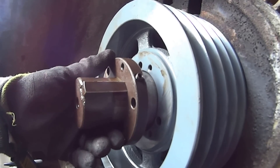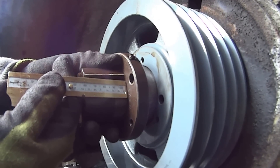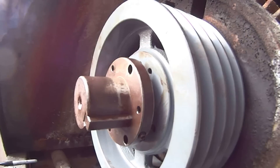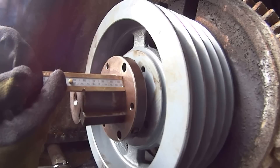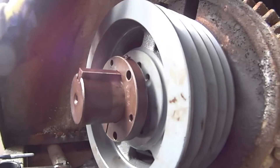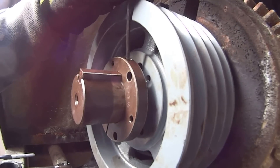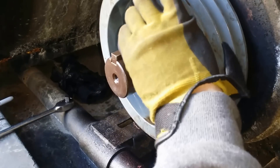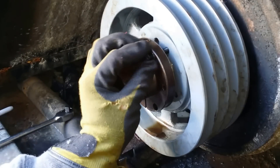Spread that tip. Get it back in line the way I had it — a little bit more. Boom, right there. I'm going to double check my alignment, which is exactly where it was. I'm going to lock in the set screw so that it doesn't move on me. Make sure that it goes in nice and easy. If you're struggling and it's going in too difficult, don't force it in there.